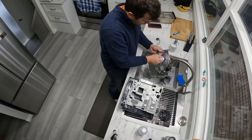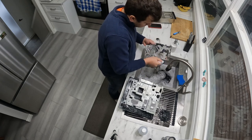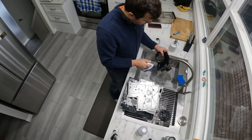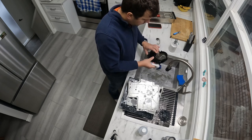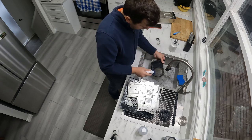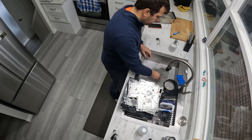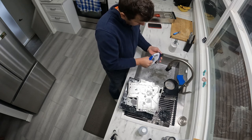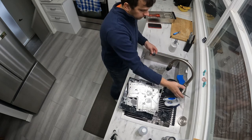I'm vigorously trying to scrub out the tar off the board, which is not worth the shielding there, but it almost never comes out like 100%. So you may have to use your isopropyl alcohol or something heavier than the isopropyl alcohol. Now I'm working on the heat sink. Making sure I rinse out the fins, rinse out the spot where the fan sits. Now I'm rinsing off the universal wall adapter on the PS3, where it plugs into the power supply.